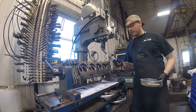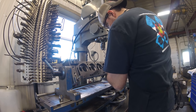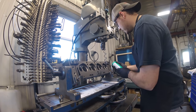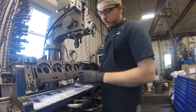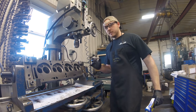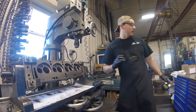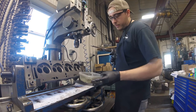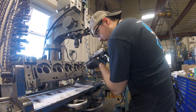Now I'm going to be installing new valve guides on this head. I'll just brush out the old bore, make sure it's clean, and I've been using this Goodson press fit lube which seems to work pretty well. We're going with a two-thousandths oversized guide because when we pressed the old ones out they came out pretty loose. We've sprayed press fit lube in all of the bores and coated the guides as well.